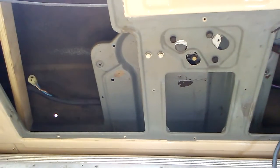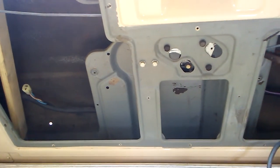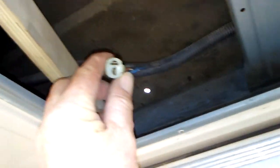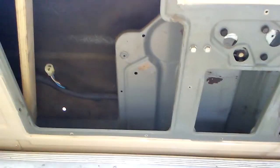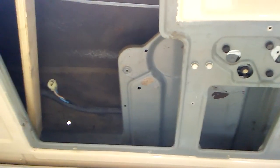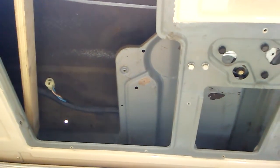The regulator and the regulator motor are attached by four screws back in here — just four simple screws. This is the pigtail that hooks up to the original motor. If you get a replacement motor, oftentimes it'll come with a pigtail because the motors have changed and the connectors have changed.